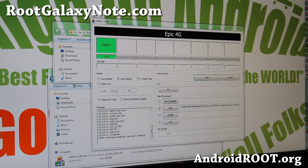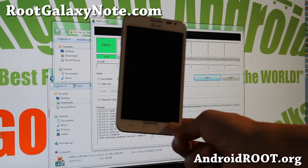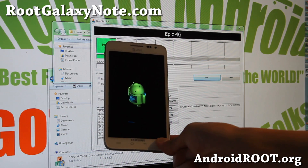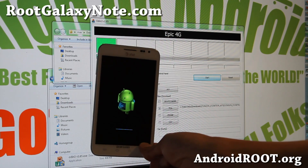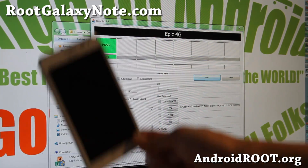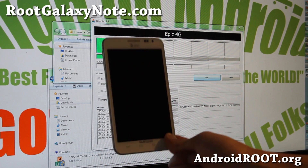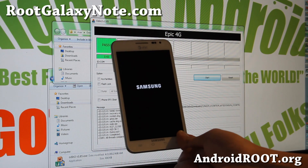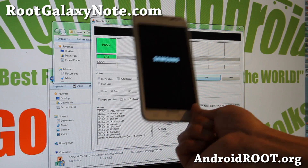The phone has reset. Let's see if it actually boots. You might get errors — you'll have to do a factory reset most likely, and again that will erase everything on your internal storage. If you're coming from a custom ROM, as I am — coming from a Jelly Bean ROM — it might have a bunch of weird things on it.